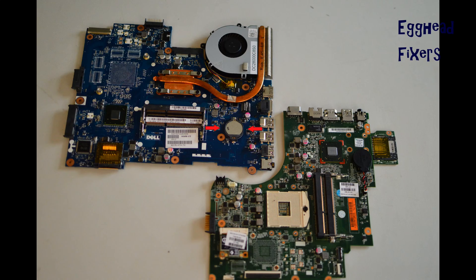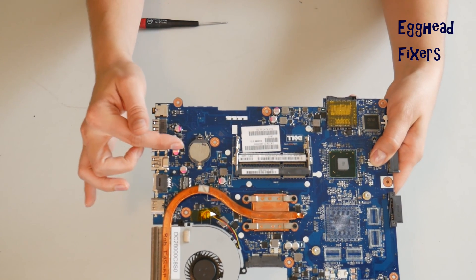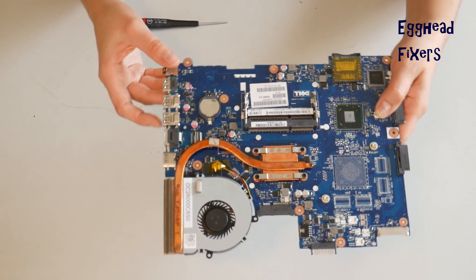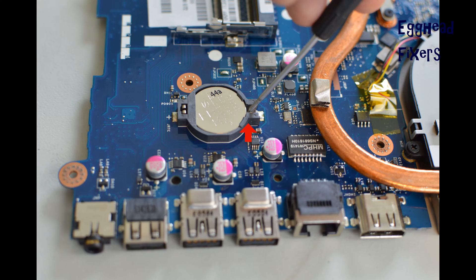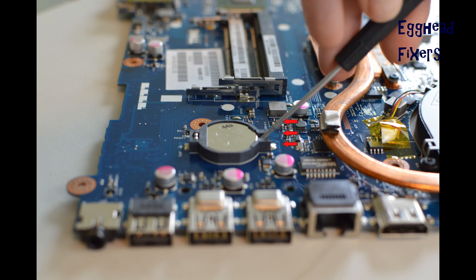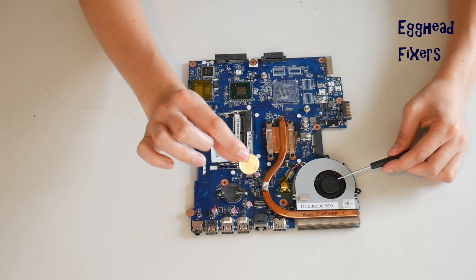Now the cradle kind of CMOS battery. Cradles vary drastically from model to model. This is the most common kind, so we'll demonstrate on that. But if your cradle looks different, you may have to adjust the way you do it — sometimes there's a flap or a piece of metal you have to move. For this kind, you take the screwdriver, set it there, and push it to the left gently, being careful not to break the cradle because once you break it, it's very hard to fix.